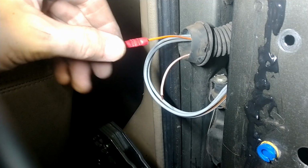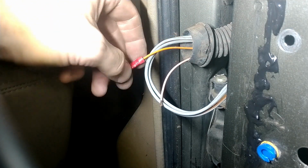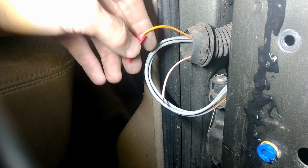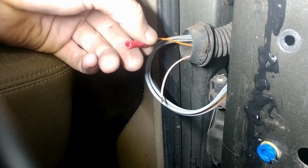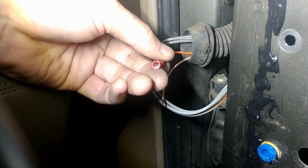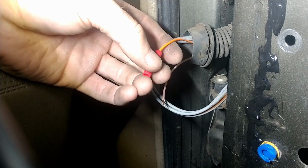Now, if you look here, rather than just a crimp that presses right in the middle, you have two shoulders, and you can see how much it's compressed in there. You see that? So that's a really nice connection. So I'm just going to do that four more times. You do want to be careful. So I did exactly half of it. It's starting to close, but you can see the opening for this wire. There's plenty of room for it to go in.